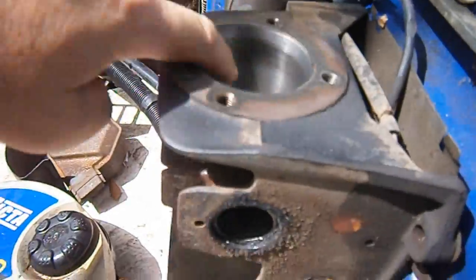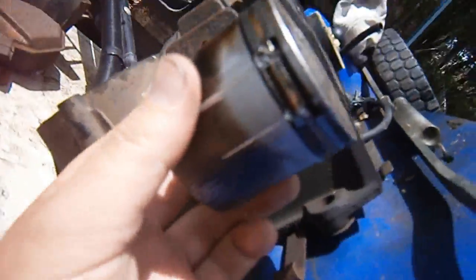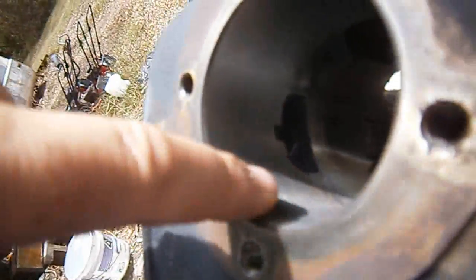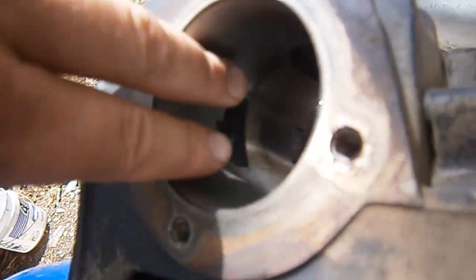The bore is pretty good. It's got a light dip there after I gave it a hone — or deglaze really. Considering where's the original piston, the piston that came out of it came out in that direction — the exhaust port. So considering there's a scar on the exhaust port side, that's pretty good to look at there, and that's where those two marks were rubbing along in that area there.